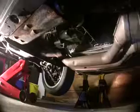It's fantastic. Common issue: power steering fluid leaks. The power steering fluid reservoir is up there. You can kind of see it from the top end. I forgot to point it out in the engine bay when we were up top. But the lines over here tend to leak. It's not a bad ordeal to fix them, but you don't want to run the pump low and you don't want to run the steering rack low on fluid. So make sure, and it's right up there, see the steering line coming down here? Make sure that those lines aren't leaking.